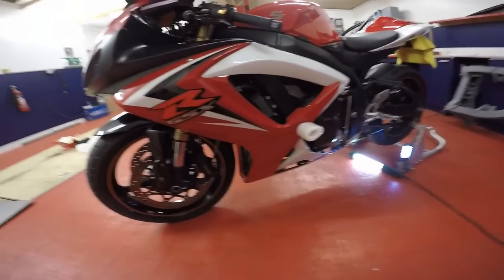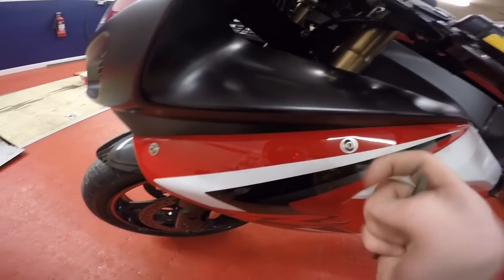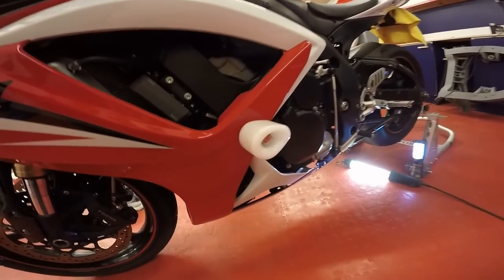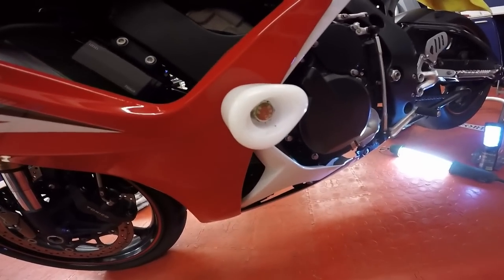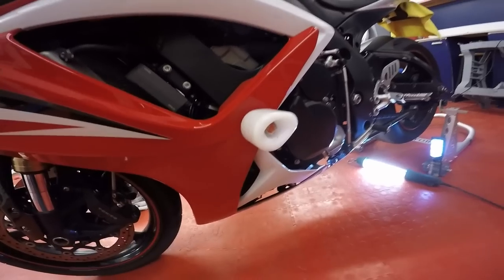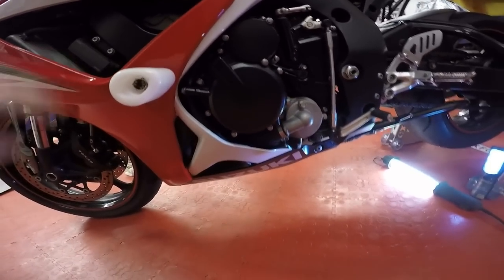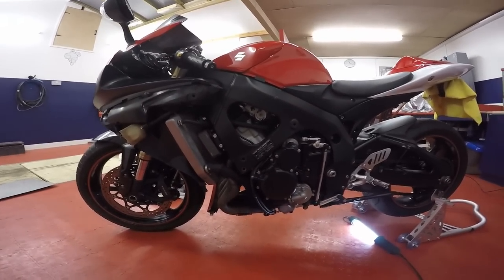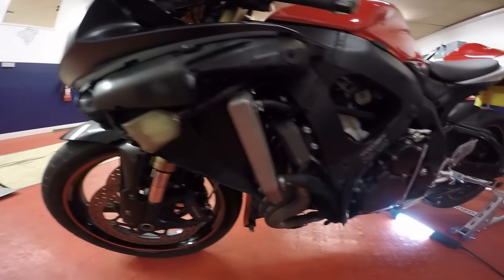For this next section I'm going to show you how to remove the fairing. You've got allen keys along here — I think they're 4mm — so you just want to strip all of these out. Then you come down here and you've got a popper system just under there, and another allen key just here. If you've got crash bungs on, which I have — R&Gs — it's got a 17mm bolt running through there with a little cap on it which I already took off. Just pop that over a screwdriver. Once you've taken that out there's a popper in here, and then the fairing should lift away from the back.